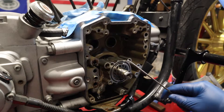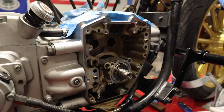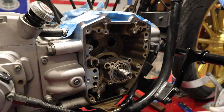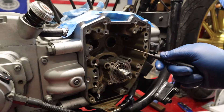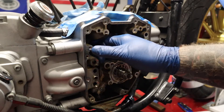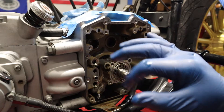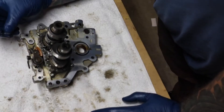Now we've got a few O-rings to take care of, like this one right here on the oil pump — lower and upper O-ring, which is here and here. I will be getting in here and replacing these inner bearings. They do feel like they're in really good shape; there's no binding or anything, so I'm probably going to replace those. It depends on whether the gasket kit I get comes with those or not. I'll get to the cam plate and actually take the cams out, because those bearings will get replaced as well as the cams, obviously. I got the snap ring out — it's right there.